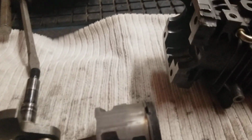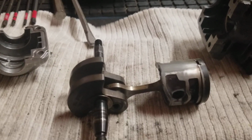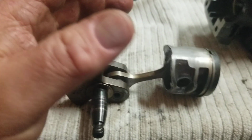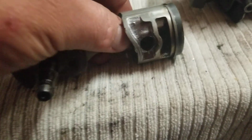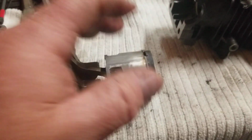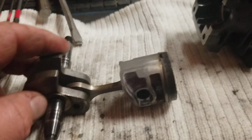When you've got a bad chain, it's not sharp. You run the chainsaw to the hottest point possible, and that causes the aluminum to start breaking down or fracture. Or you start them up and don't let them warm up, okay? That's not good. That's just bad stuff. And that's what happened. So he burned up the chainsaw by overheating it, catastrophically overheating it.